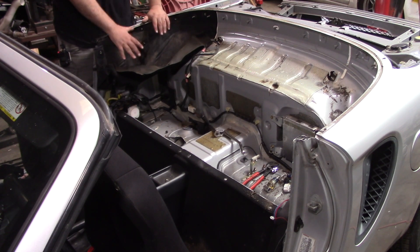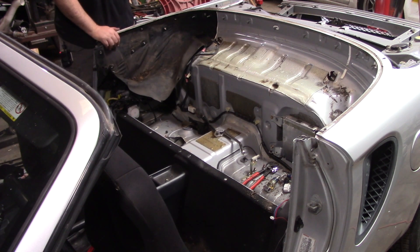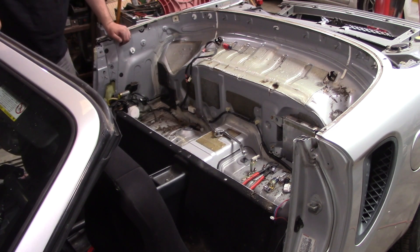I did check — the parts are still available, they're $60 a side, and frankly this is all junk anyway. When we get further down there and take the fender off, it'll be easy to pull that stuff out. Another thing I forgot to mention: I've got some fancy Willwood brakes I use on the race car. The brakes I use on the race car can't really be used on the street because they have no dust seals, but Willwood actually makes calipers that do have dust seals and I think I can use the same brackets on those. The downside — the reason I don't currently offer it for sale — is that they don't have support for the park brake system. If that's something you guys might be interested in seeing and perhaps buying, even without park brake support, write something in the comments. Hopefully a couple of you guys are actually doing this build at the same time — leave a comment if you are, and feel free to email me with questions.